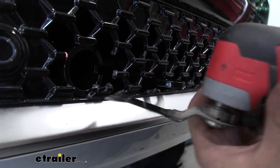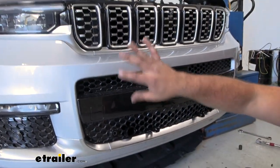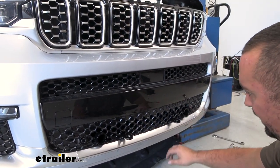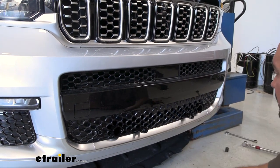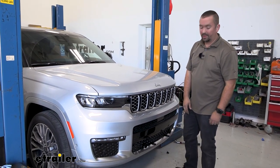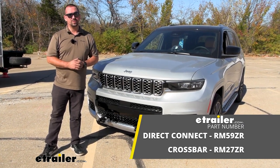You may need to use a cutting device — I'm going to use my oscillating tool to get a nice clean cut. Once I've confirmed the sides snap in, all the cuts are made. Now go back and file everything down so they look cleaner, and make sure to plug in all the harnesses and the squirters that we detached from the bumper. Go ahead, get the fascia back on in reverse order. With everything back in place, all that's left is to hook up the rest of your flat tow components and then you're ready to hit the road. That was a look and installation of the Roadmaster base plate for a 2022 Jeep Grand Cherokee L.